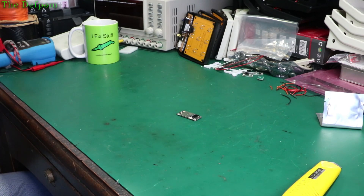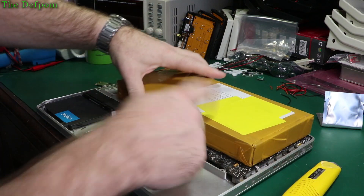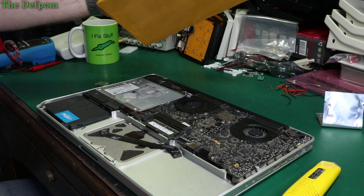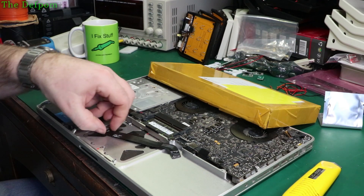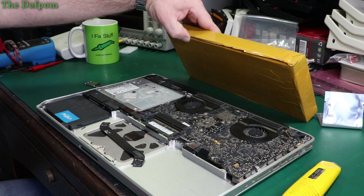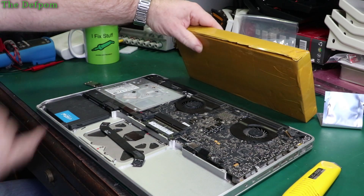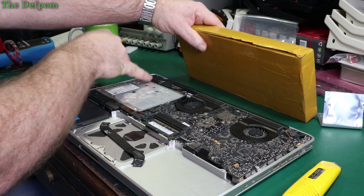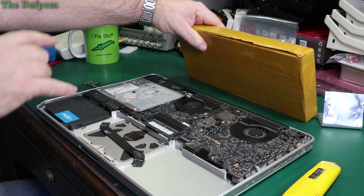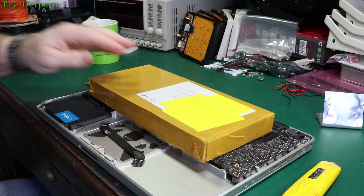This module is for the MacBook I've got sitting over here, which I'm going to show you again. I've had it sitting here waiting for me to get around to finishing it. In here is a spare battery for this machine, which arrived in the previous mailbag. I need the Wi-Fi module, and I'm also waiting for a new flex cable. This machine has liquid damage — the flex was liquid damaged and I tried to repair it but it still hasn't worked. I don't know if it's the module, the flex, or both that were damaged. So I had to buy some new ones.